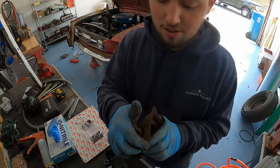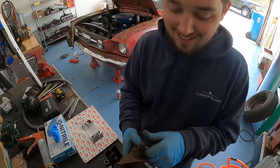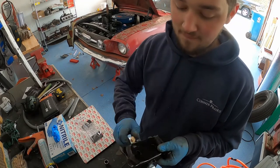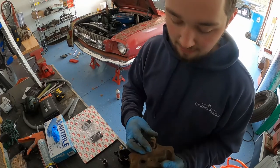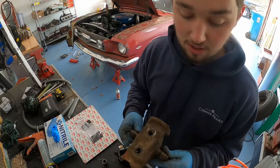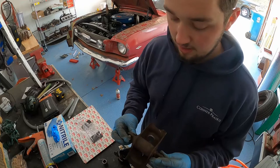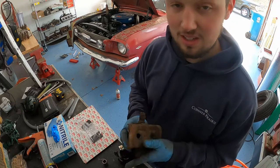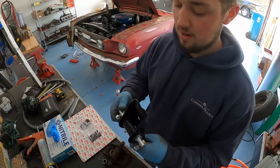There's one nut, two nuts, and it slides right off. As you can see, this isn't even in there straight anymore because the bushings are shot. This is actually supposed to turn like this one right here — it's just toast. I believe they make rebuild kits for these with new bushings. I'm not sure how you do that because these are pressed-in nuts, so I guess you press them out and press them back in — maybe. I'm going to save these and attempt to rebuild them.